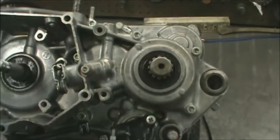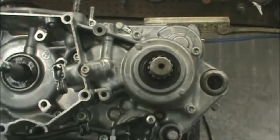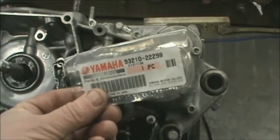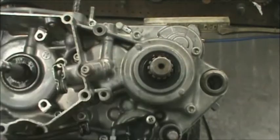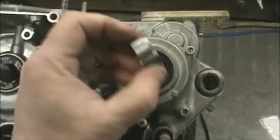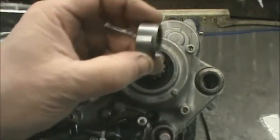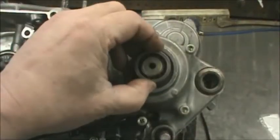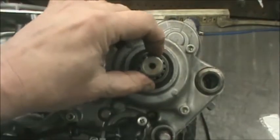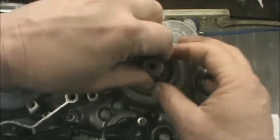Got all my seals in. While I was at it, I also put the seal for the kicker in. There's an O-ring that goes in here on the countershaft — Yamaha part number 22298. Make sure you put that in, and then put your wear ring in after that. Here's the wear ring — little chamfer side goes down. Inspect here, make sure you don't have any grooves in it. If you've got big grooves, these are cheap — just buy another one. We greased all of the inner lips of these seals with PC seal grease.